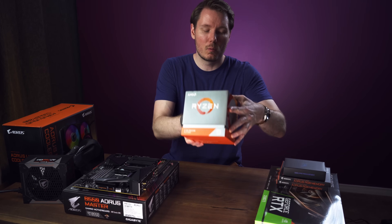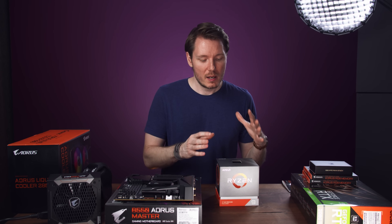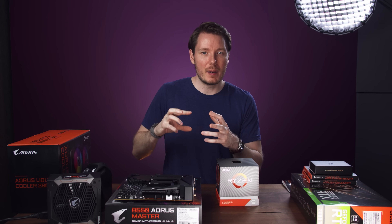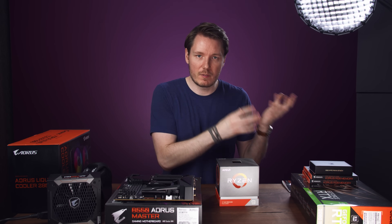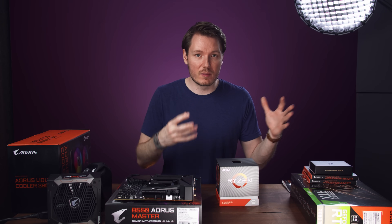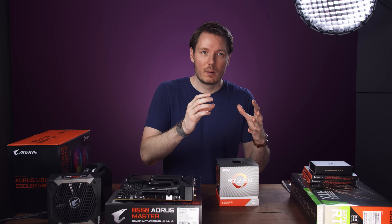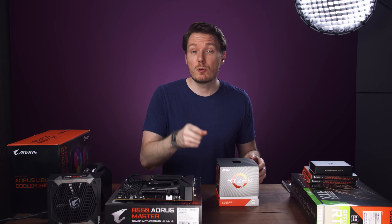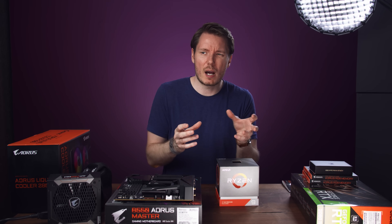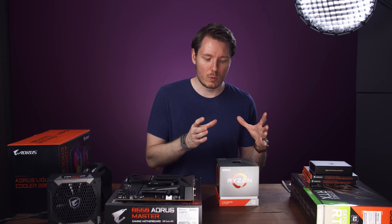Let's move on to the CPU. When choosing the CPU, this is kind of what the whole purpose of this video was. This is the Ryzen 9 3900X. The original idea behind this build was high-end video editing at the best value. What I did is I looked at synthetic benchmarks and divided them by the price of the different CPUs to see which one produces the best performance score per dollar for benchmarks relevant to video editing. Shout out to Puget Systems — they have a benchmarking tool you can download for programs like Premiere Pro or DaVinci Resolve, and it gives you a synthetic score for those specific programs. The 3900X seems to be a bit of a sweet spot for bang-for-buck.